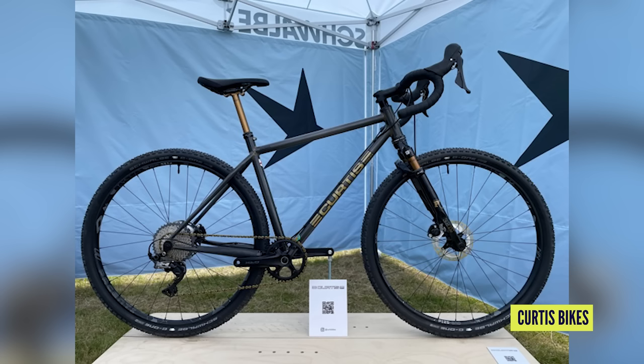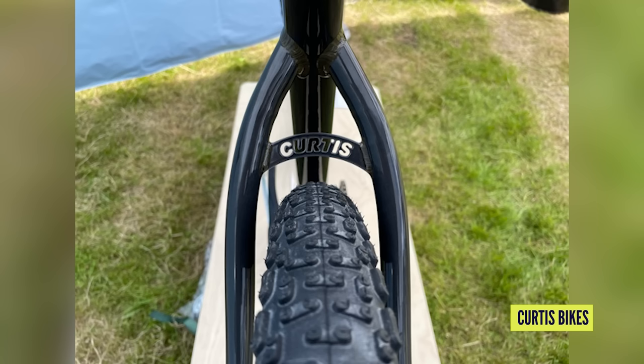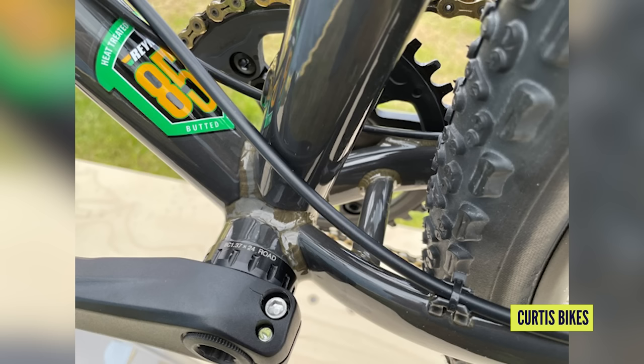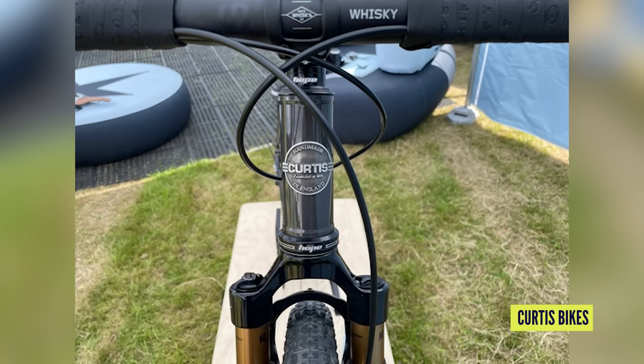I've got OG steel frame builder Curtis from back in the day — he made some really amazing dirt jump and 4X bikes. I almost got sponsored by him but I hated 4X, so I turned him down. He's still making stuff and they're still amazing. Last year he was at Bespoke with incredible frames, and now he's got a new gravel bike with lots of mountain bike DNA — slack head angle, lots of tyre clearance, and clearance for a dropper too, which is handy if you're riding something rigid. It's designed around a 40mm fork and 2-inch tyres, kind of gravel MTB. Hence the name: the Slack Jack.